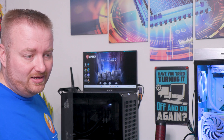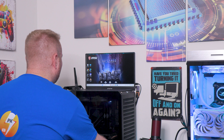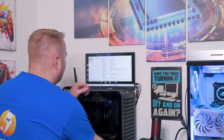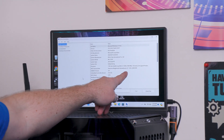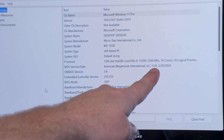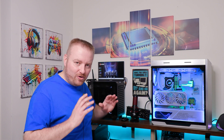A lot of times like on Asus it'll go back into the BIOS, but this particular one was a pretty quick update — it didn't need to do much. Actually, what we are going to do is pull up that MSInfo again. And right here, we are at 1H. Do you need proof? I'll show you proof. That is the best proof I can give you — that's as far as my camera will zoom in. Lemon squeezy — just like that, presto, we have our BIOS updated.